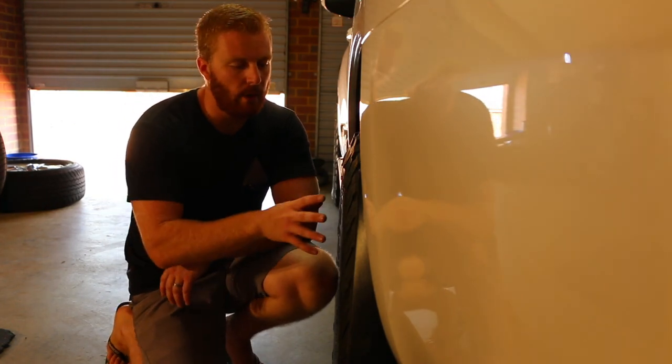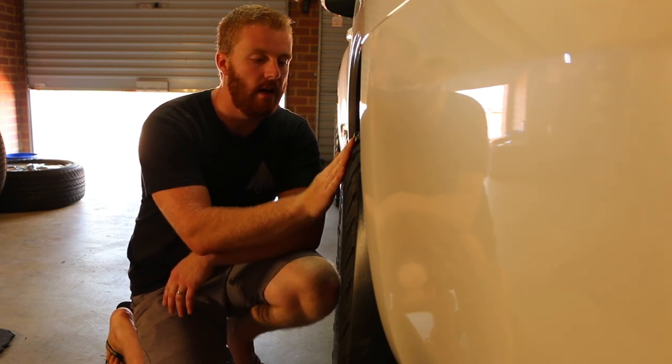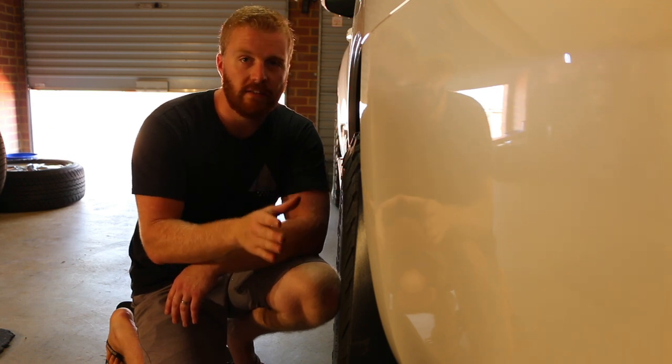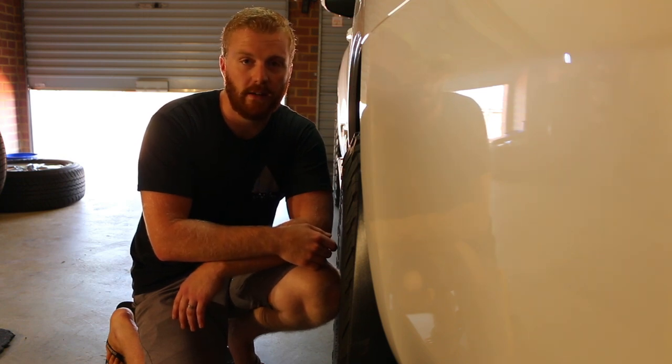This is another reason why we chose these rims. The Cruiser comes with a positive 60mm offset — we've gone down to a positive 25mm, and it brings the tire right out to those guards. With the positive 25mm offset you can see here that these tires are right out to the guards. You can just see some of the sidewall but not the tread, so still legal — but it pushes them right out, gives more clearance on the inside, and makes the car look a whole lot better.